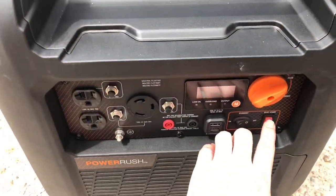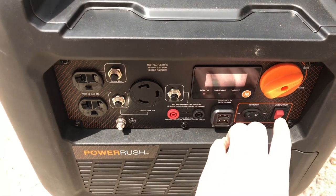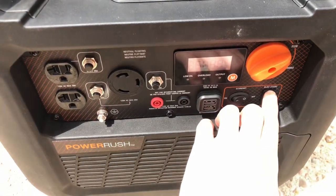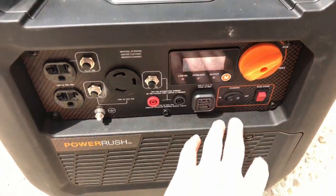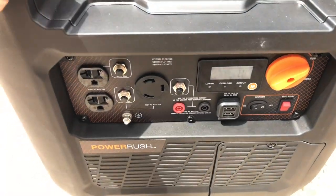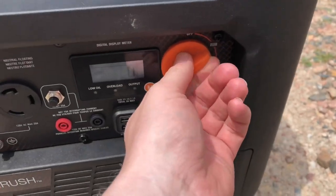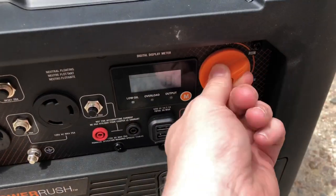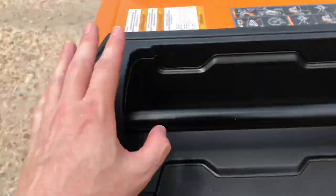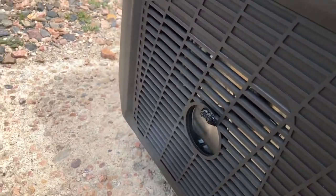It just got started and then quit, but it wasn't turning over properly. When it first turned over, I didn't have to hold down the button at all. Here we go — I did this just before and then it quit. It's running really rich; the choke is not on, it's on run — locked into place. It's definitely on run. You can see it's not producing any volts, but you'd expect that because it's not running properly. It's producing smoke.